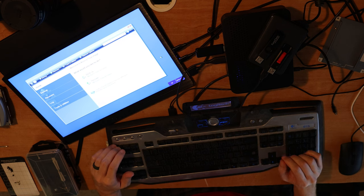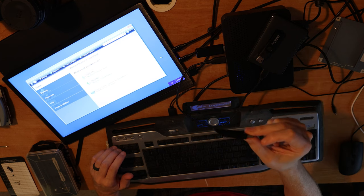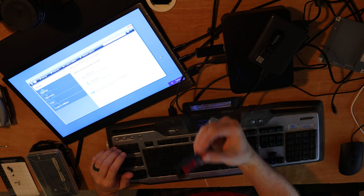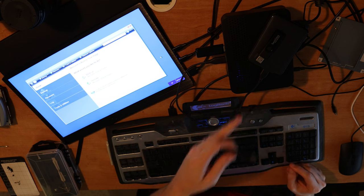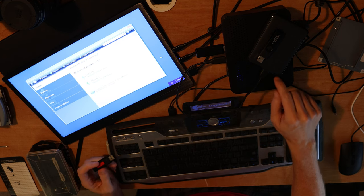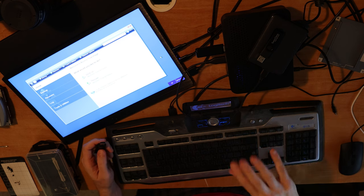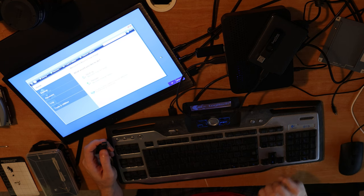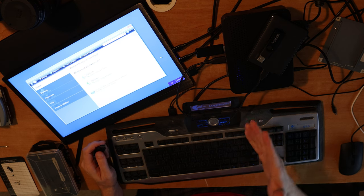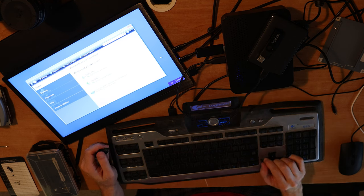What I used was this thumb drive right here. It is an Ubuntu 20 Linux bootable drive, and that allowed me to get into the drive on this device here, the Kodlix. I was able to see that there was a C drive with three partitions. There was a D drive with a single partition, so the data is there, and clearly because it will boot in the Kodlix, that's fine.